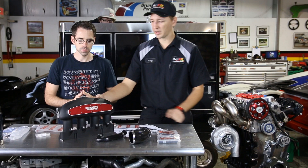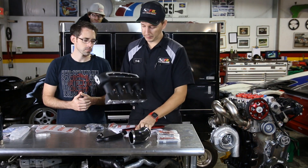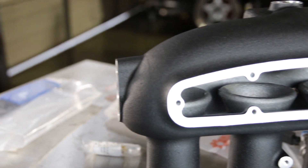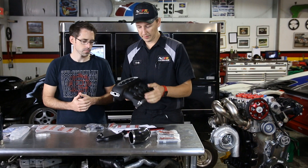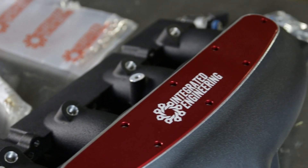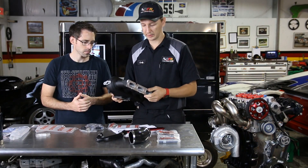On this episode we're actually going to be going over installing this integrated intake manifold. I'm going to let Cody give you a little more details about this specific manifold. So this integrated intake manifold is a cast aluminum piece with a larger plenum volume, which helps distribute the airflow better inside. They also build it with nice trumpets cast into it, which gives you a nice smooth airflow down into the individual runners. They also include ports up here which you can use for nitrous injection or water-meth, which is a lot more common, and it still includes all the places where you need to connect the factory vacuum lines and whatnot.